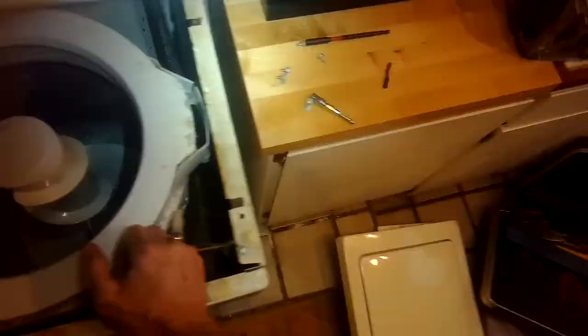We're pretty much done at this point — we just have to reassemble the cabinet. I'm going to put the forks on both sides into the holes on the bottom of the front panel, line those up, lift the front panel a little higher than it needs to be, and let it drop down under those forks at the bottom. This is kind of a difficult part — just take your time, try to line it up. You can swear and curse a few times to help you out. Then put in those screws to hold in the top of the front panel.